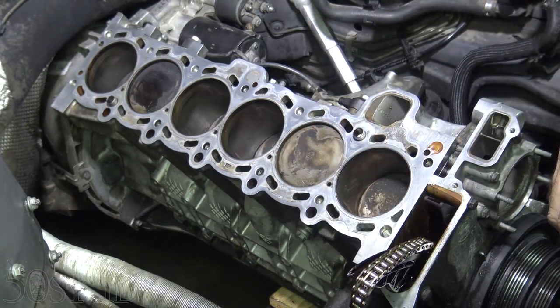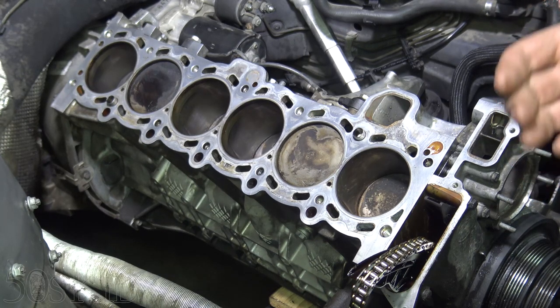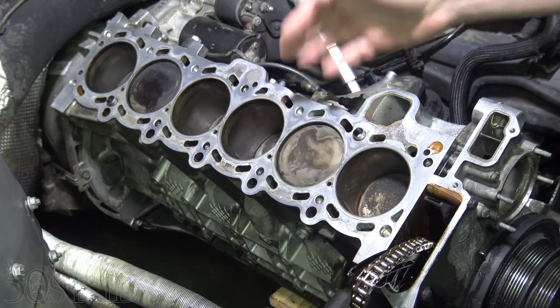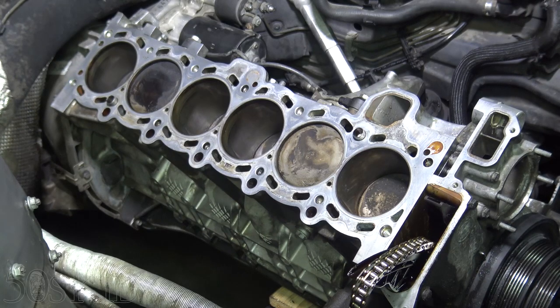Now that we have the engine block clean, the next step would be to measure it just like we measured the cylinder head, to see if it's warped. Usually blocks don't warp that much — usually cast iron blocks don't warp at all. An aluminum block is a little more prone to warping than a cast iron block. However, cylinder heads are really where all the warpage occurs because that's where most of the heat is — the explosion is taking place up in the cylinder head area. That's why blocks don't usually warp. If you're just doing a cylinder head, probably nine times out of ten you can just pop your machined cylinder head on and you'll probably be fine. So that is it for cleaning and measuring the cylinder head — that gets us all the way to the machine shop. We can deliver the head to the machine shop, have them do the work, get it back, do the final reassembly, and get it back in the car. Between now and then I'm going to be pulling out the bottom end and doing a whole host of stuff on that.